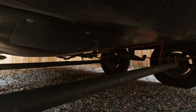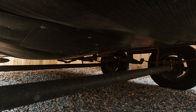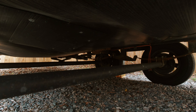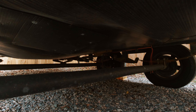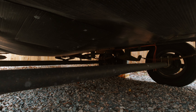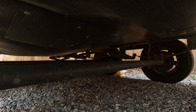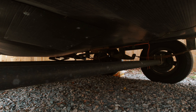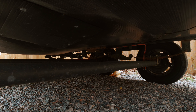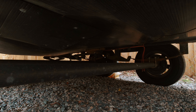This week I'm going to pull maintenance on the RV before our trip to Georgia next weekend. I want to make sure the wheel bearings have all been re-greased and repacked, check for uneven tire wear, and make a little adjustment on the back axle since I saw some uneven wear a few weeks ago. I also want to look at the leaf springs, make sure the bolts are good, and give everything a visual inspection.